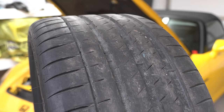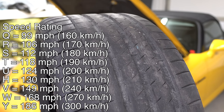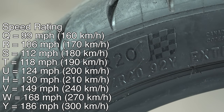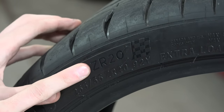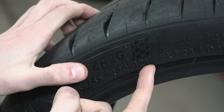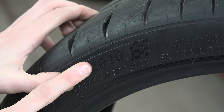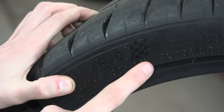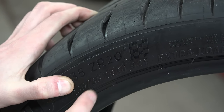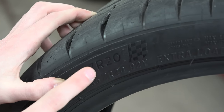You don't want to be driving 186 miles per hour on a very worn-down tire. There's quite a long list of individual letters and their correlating speed ratings — I'll include the more common ones you may see on your tire. Now going back to this Z: you might be wondering why Y is the highest speed rating and not Z. At one point, Z was the highest speed rating, designating anything over 149 miles per hour. Then cars got faster, so new ratings were introduced — Y meaning up to 186 mph — and Z became irrelevant, now more of an aesthetic choice.